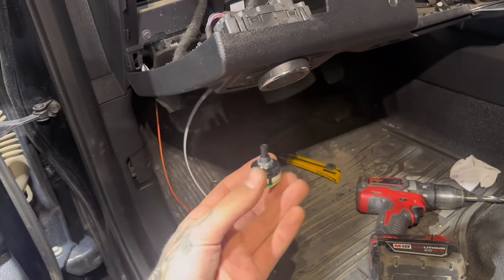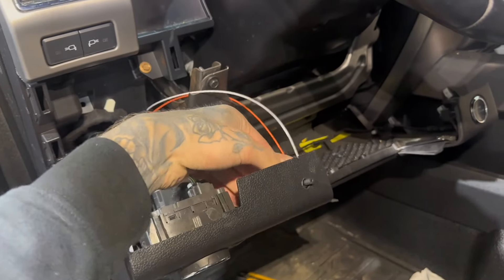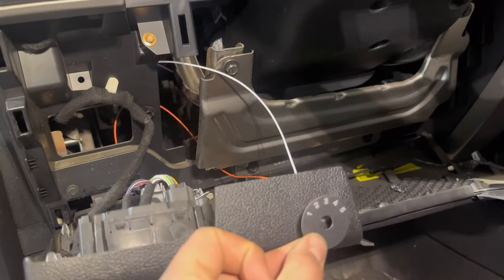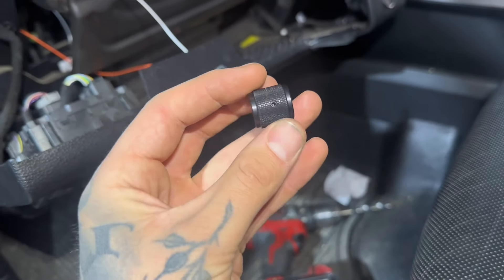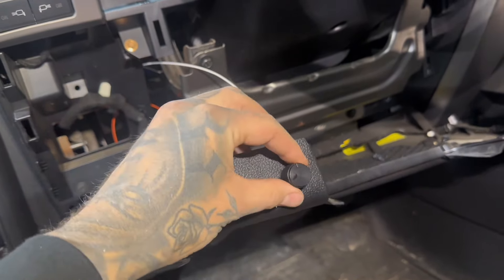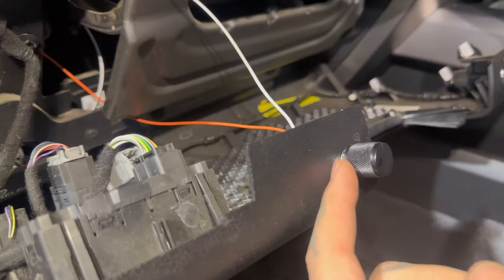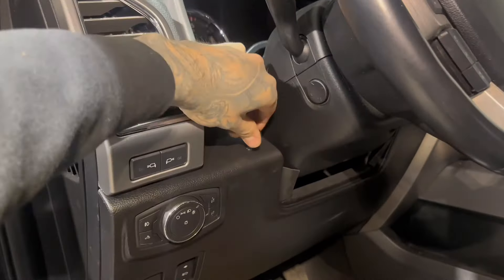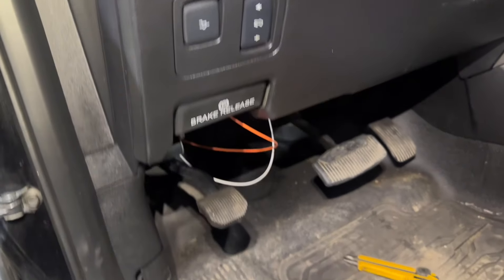Run your switch up underneath the dash and out through the hole. Take the nut off, pop it in the hole, then put the washer and nut on and tighten it up. The kit comes with a sticker you can put under the nut, but I think they look tacky. Now put the knob on — use the little allen key that comes with the kit, loosen the set screw, slide the knob on and tighten it up. If the switch is hard to rotate, loosen the set screw, pull the switch back a little and retighten — sometimes it rubs on the nut. Pop the panel back and clip it into place, being careful with the wires, then zip tie the wires underneath, nice and neat out of the way.